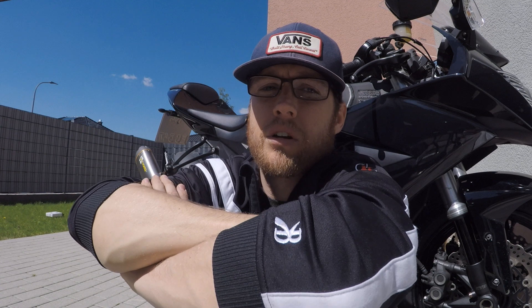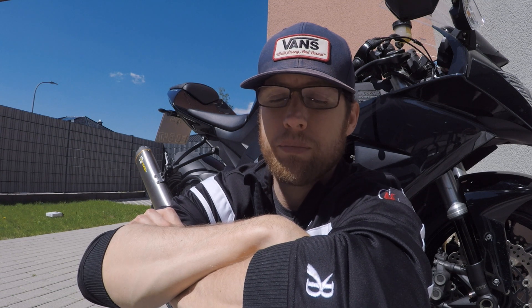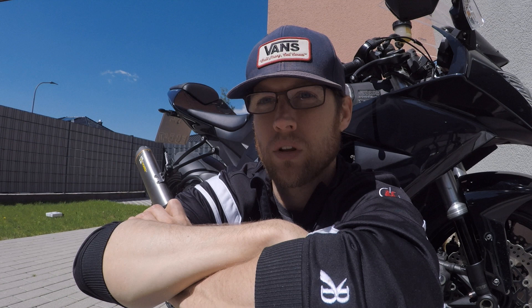I'm only trying to get 350 to 400 horsepower out of it. It's got to be somewhat reliable — a nice little fun car I can take to the track, but mostly just reliable so I don't have to do this again in three or four years; it's quite expensive. I also bought an 11mm oil pump since it had a 10mm, so we need a little more oil pressure. I've got an FP Blue turbo going on it — I was initially going to go with the Blouch 18G, but guys told me the FP Blue would give a faster spool and less lag.